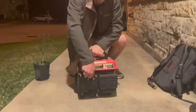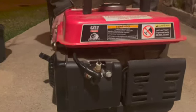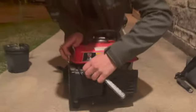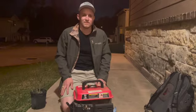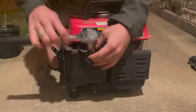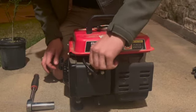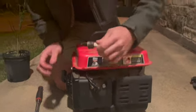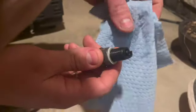The easiest thing to check is spark. This is a one-cylinder two-stroke, so it has one spark plug. You take that out — it is not a three-quarter socket, so we had to go to the truck for a different one. Now we have acquired the proper tools. You take your spark plug out — we can check for spark, it's pretty easy to do. The first thing I'm going to look at is how old this is and how sooty it is. First thing you do is wipe it off real good.